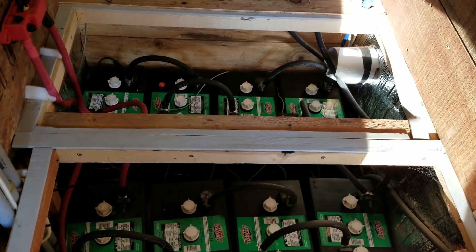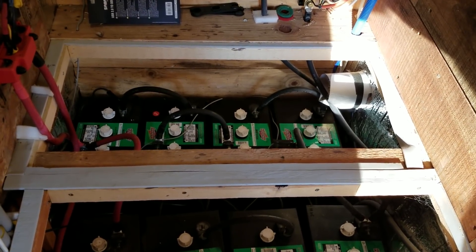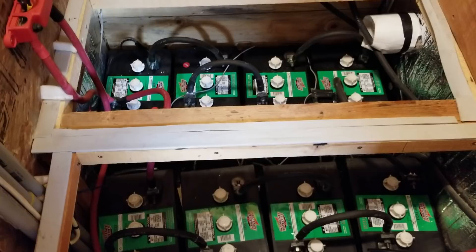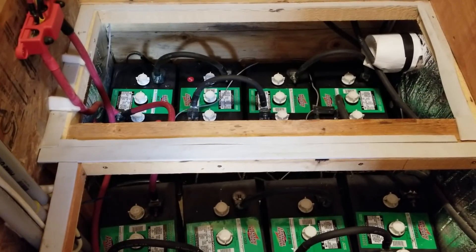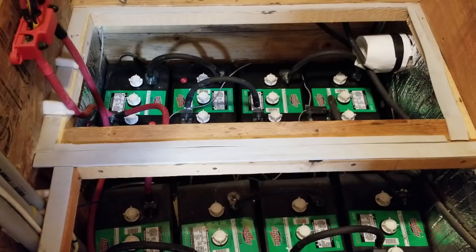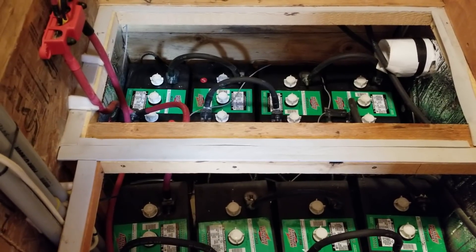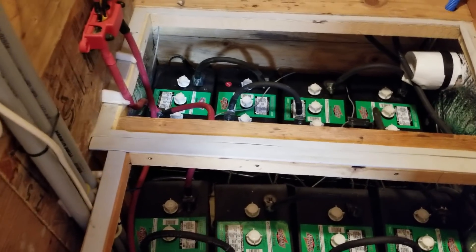It's been difficult finding the right voltage set point for these batteries. I got a hold of Interstate and they told me 30 volts for absorb on a 24-volt system, but I could never get my specific gravity up the way it was supposed to be. I found an old posting from an engineer saying it was 31 volts. I finally got a hold of an engineer from Interstate and he said 30 volts is right — but then realized I had a 2014 battery, not a 2018. In 2014 they used a different battery chemistry, and 31 volts was the right voltage.